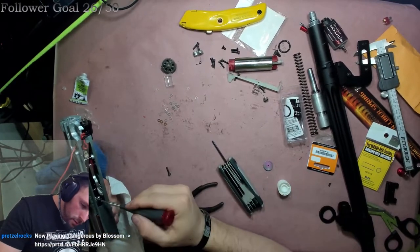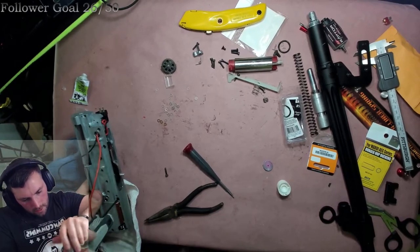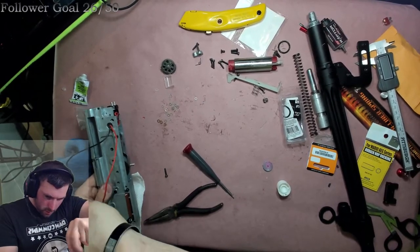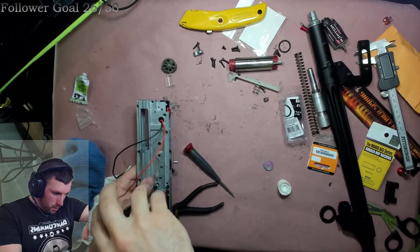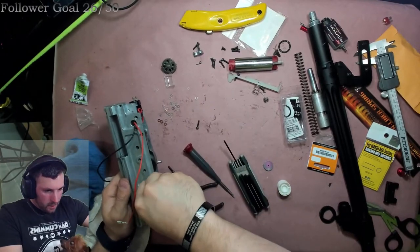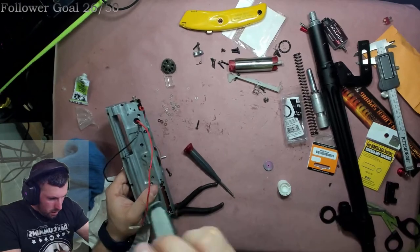All right, so check that. Moves just a little. So we're gonna turn this. I'm gonna put one very, very thin one on the top. So the 0.1 millimeter one, that's what's gonna be on the top. And then from there, I think our shimming should be, if not done, good enough. And then after that, we're gonna install the barrel and then do the Deans connector, and remove the fuse.